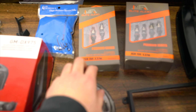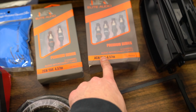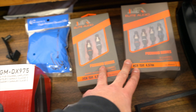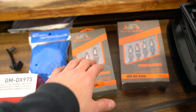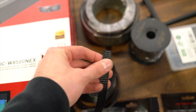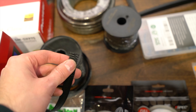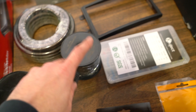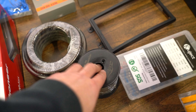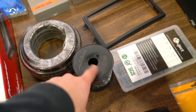I've got my RCA cables back here — a two-channel 15-foot and a four-channel 15-foot. Four-channel for the speakers, two-channel for the sub. I don't think I'm going to need the whole 15 feet, so I want to pull these out and see how much I do need. Then I have my speaker wire up here, so I need to get that out and see how much I'm going to use. I bought some expandable snakeskin sheath for wire — I think I'll put the speaker wire in one and the RCAs in the other, but I need to figure out how long this wiring needs to be running from back by the head unit to the amps.